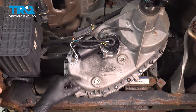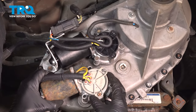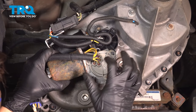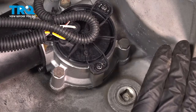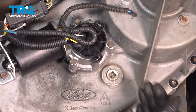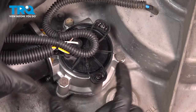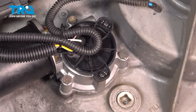And there you have it — now you would test it out. That's installed, but there's one more thing to pay attention to: the adjustment and clocking of the motor shaft. Look at the old one and make sure the positioning of the screws or the cap looks the same as the new one. If you test it and have trouble getting into four-wheel drive or getting back out into two-wheel drive — like it feels stuck in four-wheel drive partially — most likely it'll be these screws. They need to be adjusted; clock the motor properly in either direction until you can get in and out of four-wheel drive smoothly.